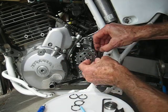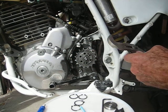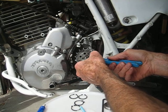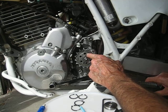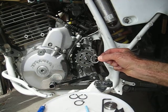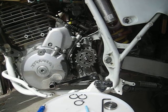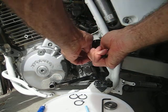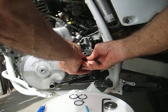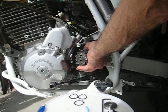I want to make sure you can see this. I'm just going to very gently, with my channel lock pliers, squeeze that. I've got the slot at the top, slot at the side, I'm just going to rotate that 90 degrees, and then I'm going to get my trusty heavy-duty snap ring and snap ring pliers and install this thing right in front of your eyes. There's no movement, no rocking.